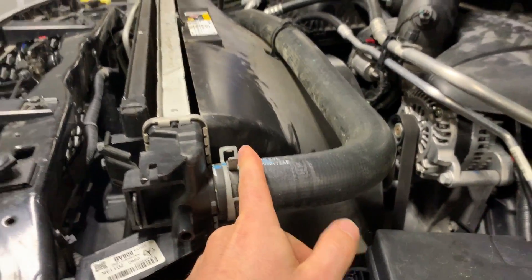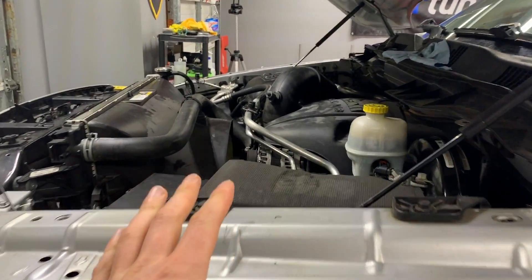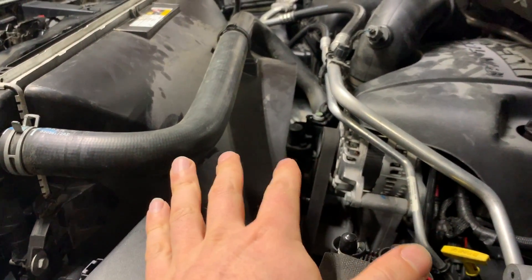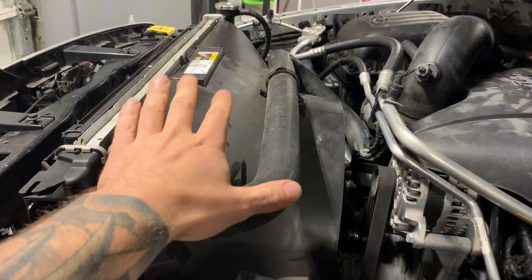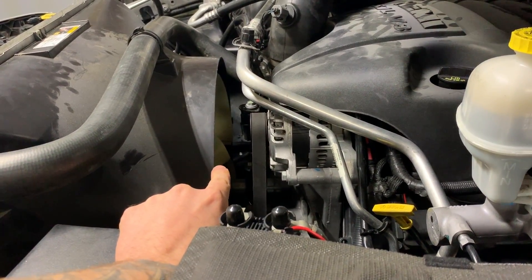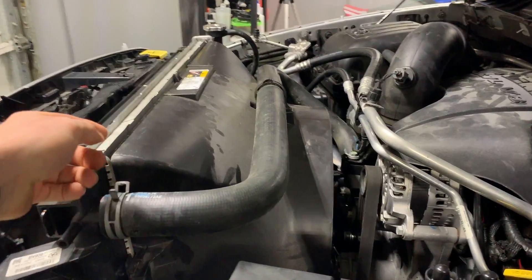What happens is if you turn on your air conditioning, or if the engine gets too hot, it'll kick in the secondary fan in order to cool the radiator, the condenser, whatever's going on at that moment. What most people will do — and you can check back in my other videos — is you can remove all this, take out the stock standard electric fan, because this shroud is essentially formed to fit the mechanical fan. If you just left this shroud with that electric fan, it's not going to be optimum because air can still go around it and pass.